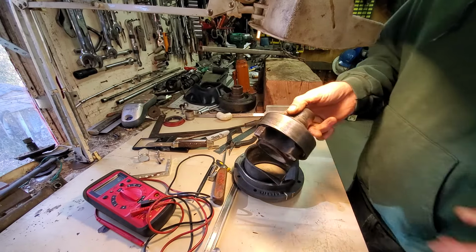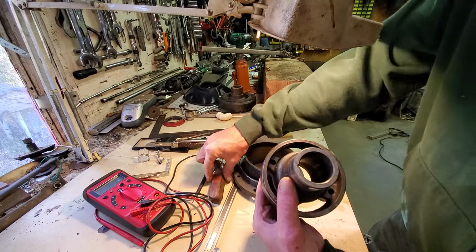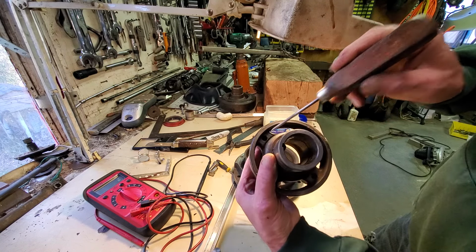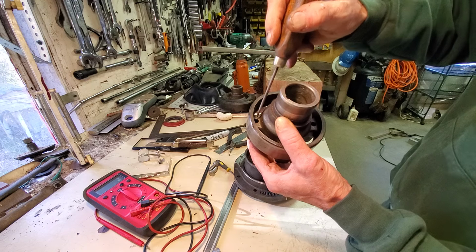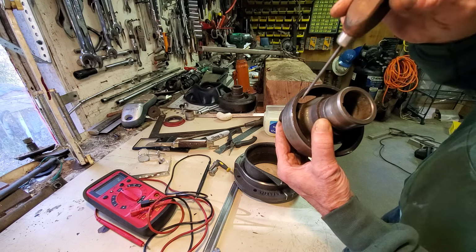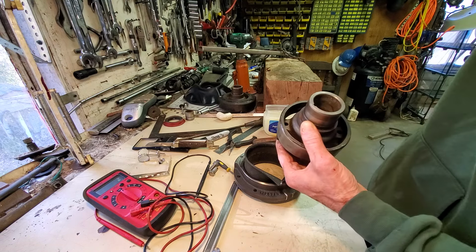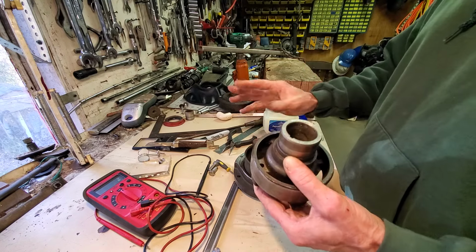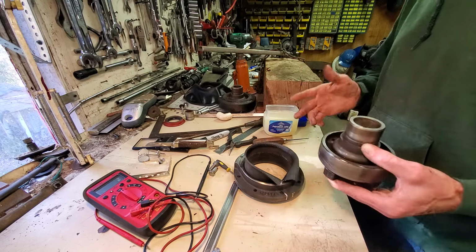We talked about how to clock this in the previous video. One of your flanges will be different. It'll have a foundry stamp. Go to a previous video and you'll see. There'll be a foundry mark, and that's the one that you clock. And you want the center line of this mounting hole to be at 1 degree before top dead center, for some reason. The reason I say that is because I compared 4 harmonic balancers and all 4 are the same. That's all I know. I don't know why. I just know 1 degree seems to be consistent with all of them. So, it is what it is.